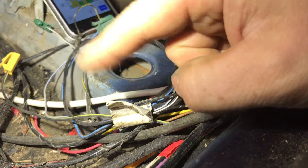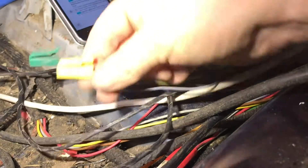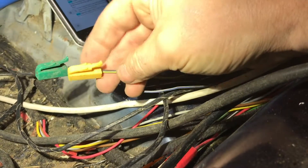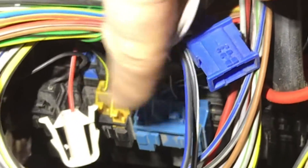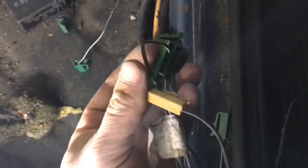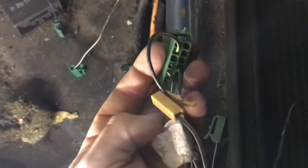At the end of the D loom you have all these little auxiliaries — I actually hate these because they don't plug directly into anything you can spot easily. Where do they go? If you look at the very back of the top of your fuse box, you can see they all plug in. The rule of thumb is the same color plugs get plugged in together. Counting down from the top, left-right — so this big heavy yellow and black wire with a yellow plug, we're going to find it inside here.